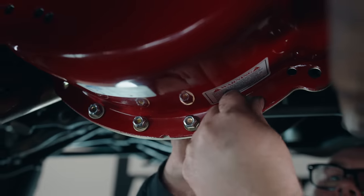Gary hooked up the broken speedometer cable and installed the transmission crossmember. He also put on new high-quality nuts and washers from his shop drawers — the man seems to have every part possible stashed away. Then it was time to reconnect the exhaust. My dad ran to the parts store and picked up new exhaust gaskets — we used graphite gaskets, which are supposedly way better and super thick, so hopefully no more exhaust leaks. Gary put anti-seize on the exhaust bolts and adjusted the clutch linkage to eliminate any slack. We also noticed the clutch linkage was missing a spring, which I need to order. Gary installed the driveshaft, greased the U-joints, added new transmission fluid, then lowered the car. My dad installed the shifter back in the Mustang and we confirmed the car properly shifted through all gears.